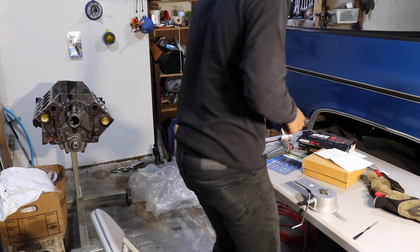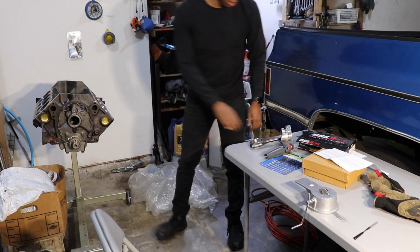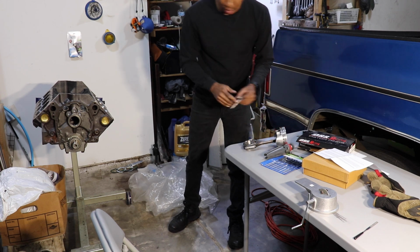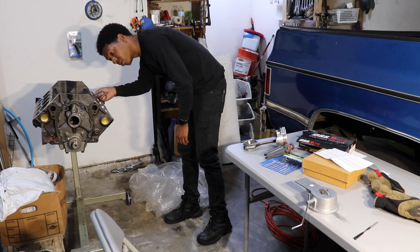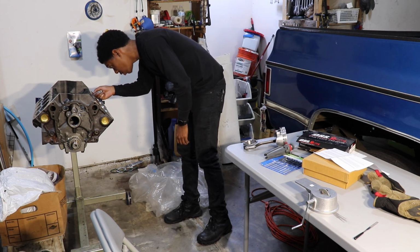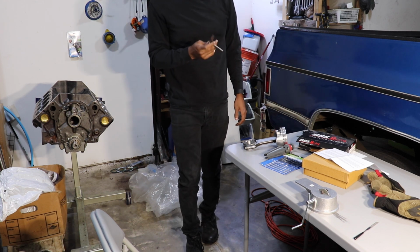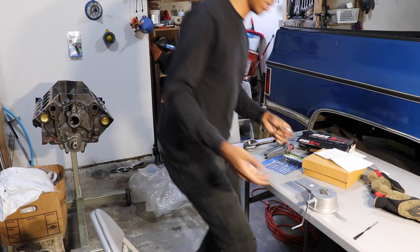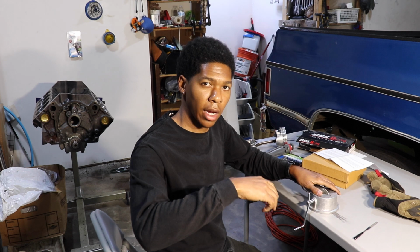Let's see if we are getting anywhere. Feels like it's getting somewhere. So looking for 0.010, and it's just barely able to accept the 0.010. This time, because I want to see it accept it, I'm going to do 50 now. See, I kind of start dialing back as I get closer to where I want it to be.